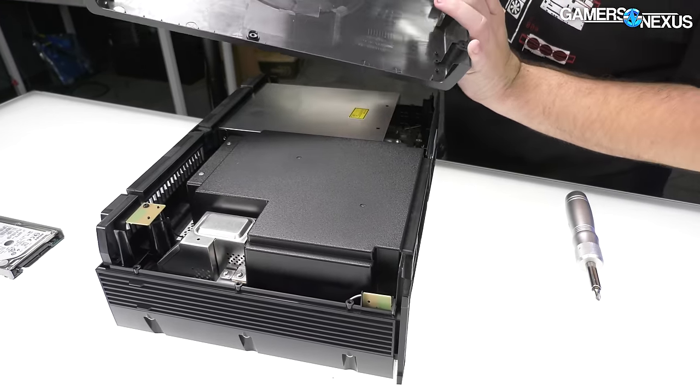There are the fans — 240mm total — driving all of the intake we've found so far. The power supply spec: the consumer PlayStation 4 Pro is a 310-watt unit, but technically the 12-volt line we calculated can go up to 330 watts, with the 4.7V by 3A line adding another 14 watts or so. The interior also has one cable running diagonally across — that's the wireless antenna — and another for the Bluetooth running the other way.